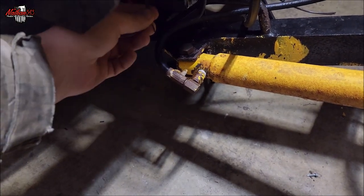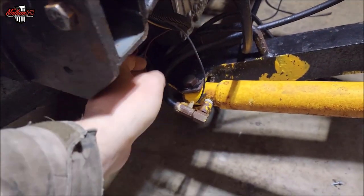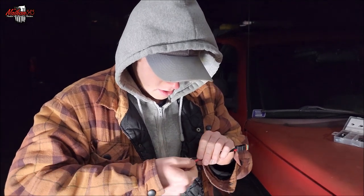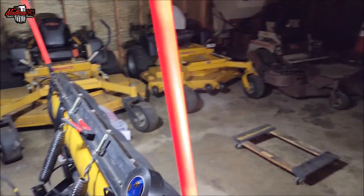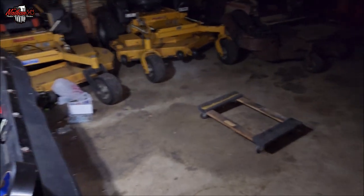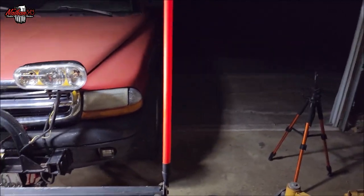Zach is going to hook into the brown wire — he's cut it and is hooking that to the brown wire and the ground wire, and it'll be running lights. I was going to make them running and turn signal, but there are only two wires in each light, not three. So it'd be cool if they could make these with a third wire to make them turn signals too. Josh, if you're watching, maybe make a third wire on these to include turn signal functionality.